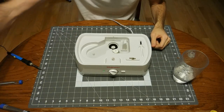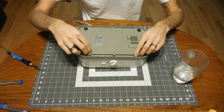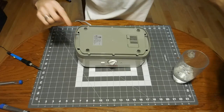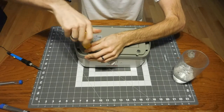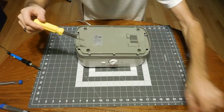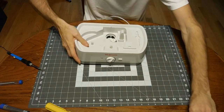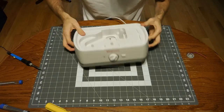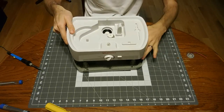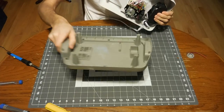I'm going to dump this water out and come right back. Okay, I'm back — got it emptied out, it's unplugged. On this model you've got to pull these four rubber feet off, and then down inside there's just a Phillips screw in each hole. Once the four screws are out, you just pull it up and that goes right off. You've got the power transformer and power supply — we can set the base aside.